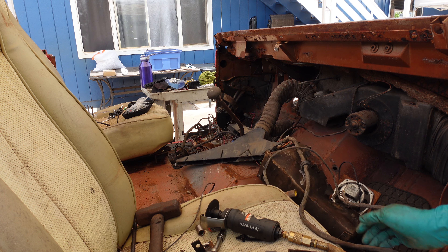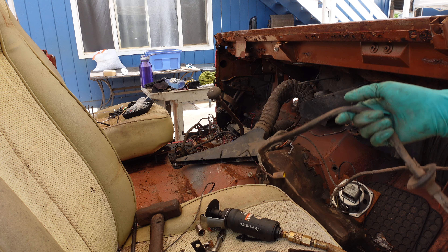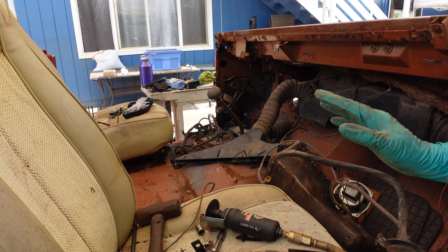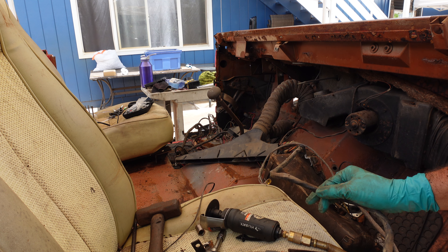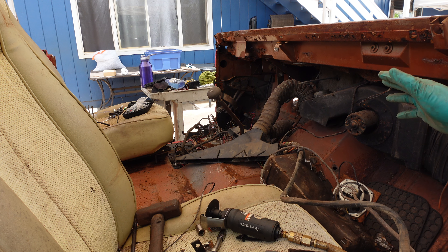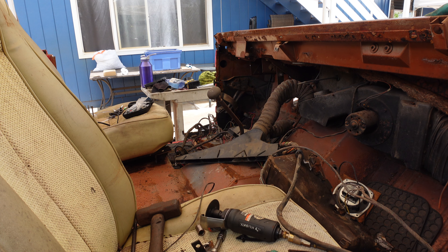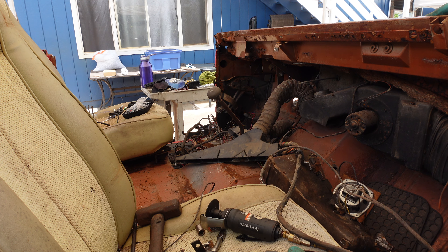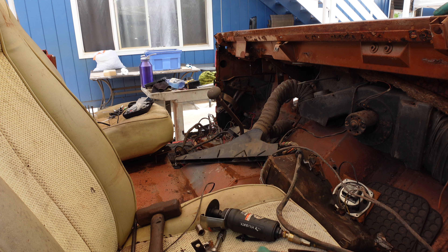I'm going to take off the wiring harness from the vehicle. I'm keeping it together as much as possible to use it as a base when I rewire the vehicle, though a lot of it I won't reuse. No fan needed since it's a roadster. Also, old Fords like this have an external voltage regulator, but I'm going to upgrade to the 1G or 3G alternator which has its own internal regulator — I'll show that later. I think I'll do another hour of this before frustration sets in from all the rusty parts.